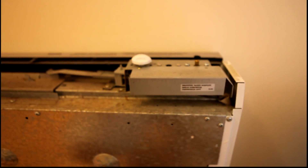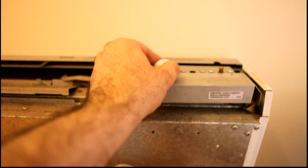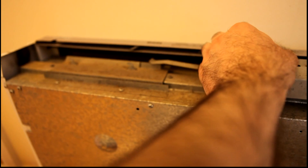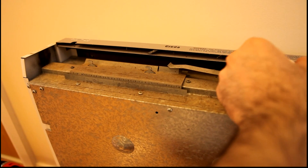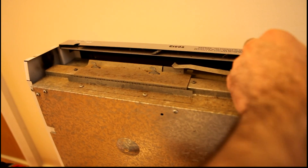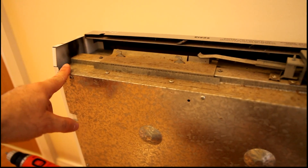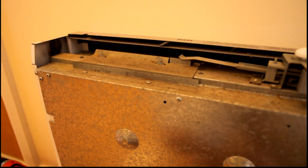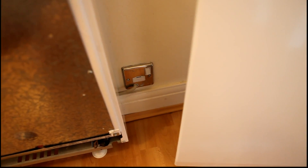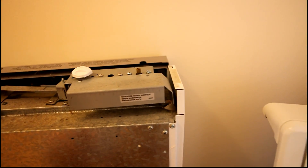What about boost heating? Unlike the other one which has a fan heater, this one has a spring-loaded output knob. When you turn it, it opens a flap on the top of the brick cavity. Turn the output up - flap opens; turn it down - flap closes. There's quite thick fiberglass matting insulation in the top of the cavity, so by opening the flap you allow the heat out more quickly. That's it - no other controls or electronics, just a simple resistive element switched by the meter and a single simple bimetallic electromechanical thermostat.